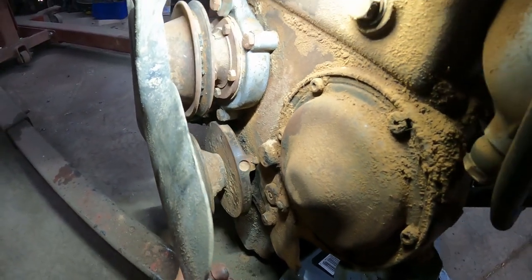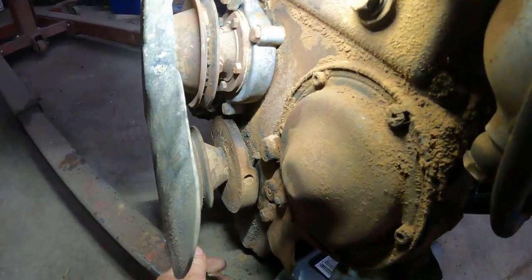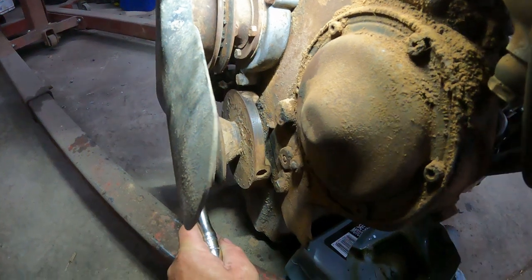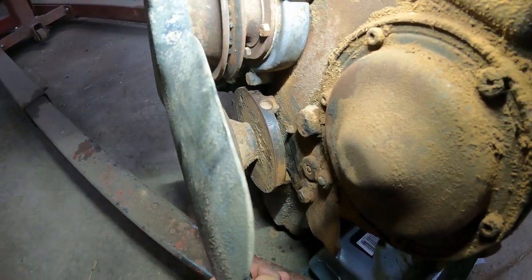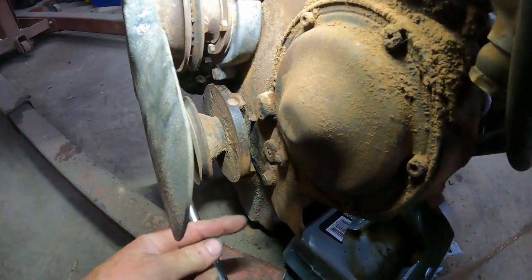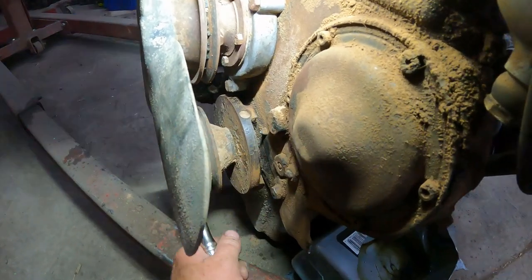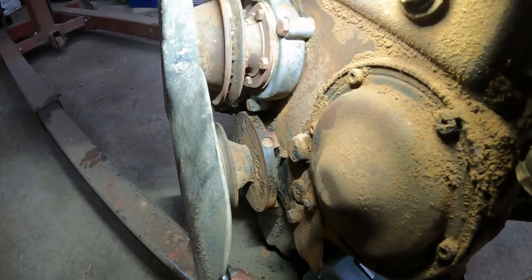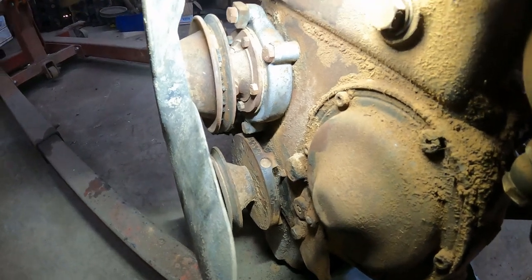So if we slowly back up, which yes, it's not recommended, but again, I got the valve train inside here. So now we're at 40. This is advanced. We're turning clockwise this way. So the first numbers is our advanced timing. And this is where we should be, 26. This pump was at 25. It will run for sure.